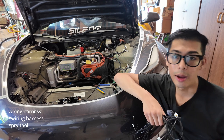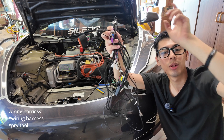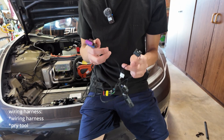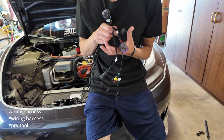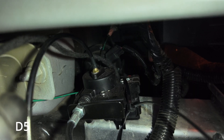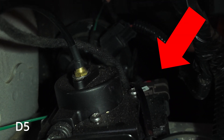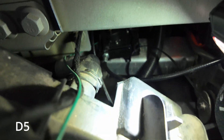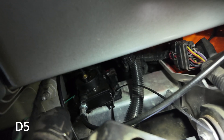The wiring harness is long — there's a lot to plug in. We're focusing on cables D5, D6, D7, and D8 first. D5 plugs into the emergency release latch — it clips on there. It's the black wire, not the green one, and it runs all the way to the controller. I mounted the emergency release down on the brace behind the fog lights and zip-tied it down.